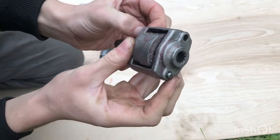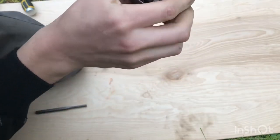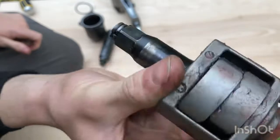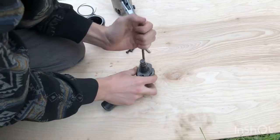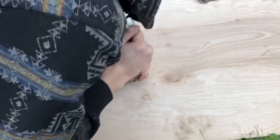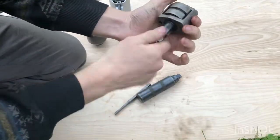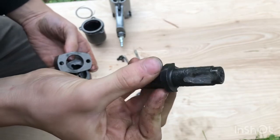These pins slide out. There's one. Ooh, this one's seized or caught. That could be the issue all along. It was put together wrong one time. So when I rebuilt the gun last time, I did the bearings and all the air stuff. I didn't even touch this because I didn't have anything for the kit in it, and I didn't know how it worked. So that could be the issue. There it is. Well, that's a problem. See that anvil sheared?